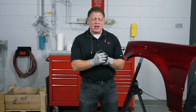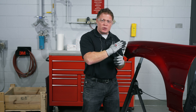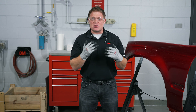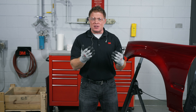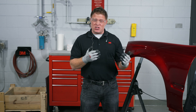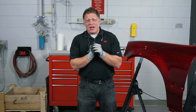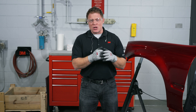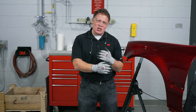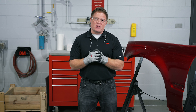We can create too deep a scratch by putting too much pressure while we're sanding onto the panel, and that can cause the scratch to become slightly coarser, which would be inconsistent — and that can also be highlighted by these ultra-fine metallics and the very challenging colors out on the market. If we don't use dust extraction we're not giving ourselves the best opportunity, because dust can land in the bottom of that scratch and create challenges further on down the line.